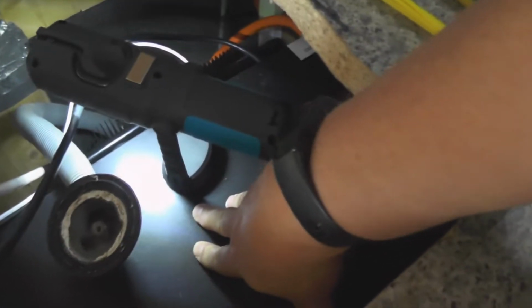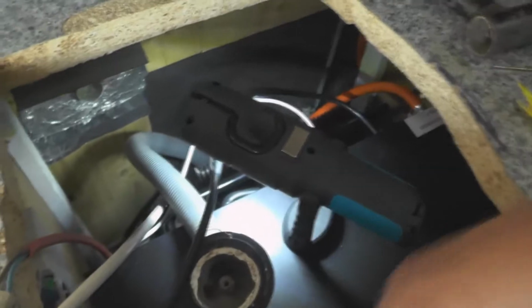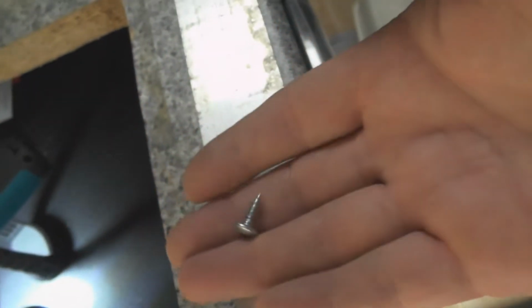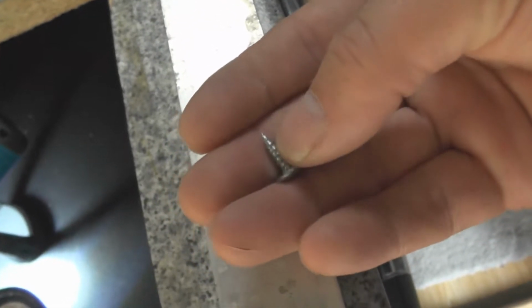Also I'm working on ways to secure it, because it's not a proper camper van fridge and I don't want it rocking and moving about. So I've checked this. This is a nice metal top, and I've cut myself a little piece of angle iron, which I'll position exactly, and that will go against the wood and into the roof of it. I'm using some very shallow screws so that they don't penetrate deep into the roof of the fridge. I don't want to compromise it in any way. But I've also had a look to make sure, and it's fine. I'm happy with the position.